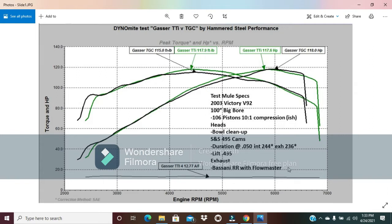What we see here is two intakes that are very similar. They're pretty even up to about 4,000 RPMs, and then the longer runner design of the Lloyd torque tubes starts to really help out the mid-range, giving it a bump of about 3 foot-pounds of torque across most of the graph. Then when we start moving over here at around 5,800, they even out. When we move to the top of the range, we see that the short runner 3rd Gear Customs intake picks up somewhere in the ballpark of about 2 to 2.5 horsepower.